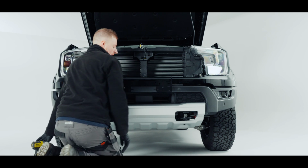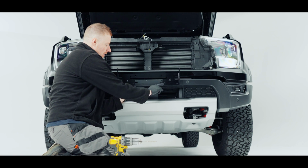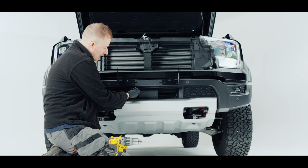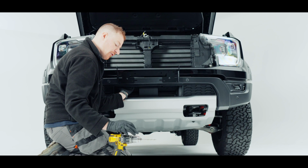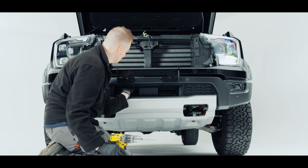So I'm going to get an 8mm drill bit and pass that through. So the loom that runs along the back of here, I've put my hand up underneath and I'm just holding that down. You could hold it up, whichever's best for yourself. And then your drill bit, put as far out in the chuck as you can to get as far back as you can.